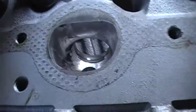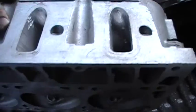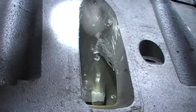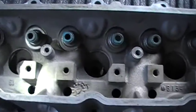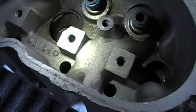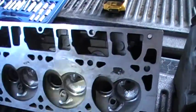So I cut the guide down, cut this up, and I really didn't make the intake ports bigger because I didn't see any point. The big thing is I cut that hump out — I'm not done yet because I didn't have a bit long enough to reach it — and that actually cuts into where the rocker stud bolt is. But I've seen pictures and videos of other people porting them, I guess that's a common thing to cut into, and then you put your bolt back in there when you bolt your rockers down and it seals up the hole. I don't think it hangs into the port that much, so it actually should flow better.